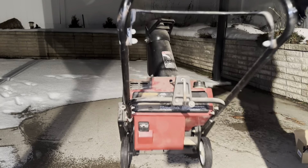Here's the carburetor. To get this cover off, there's going to be two screws — this is 3/8. We're also going to take these three screws off over there, and that's going to expose the spark plug which is underneath this. That is 5/16ths.